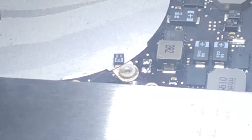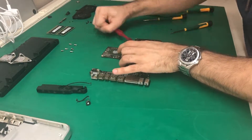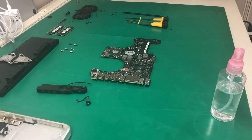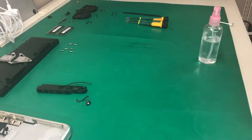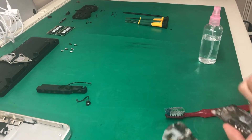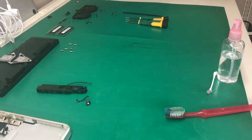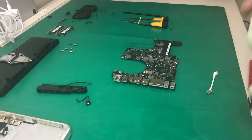This is a super common thing — on almost all these Macs that we get, we replace these caps just in case, because it can cause a lot of weird behavior and symptoms on this particular board. Whenever we get an iffy-acting Mac of this generation, we just replace that cap and retest. In like 90% of the cases, all the problems disappear after we replace this capacitor.